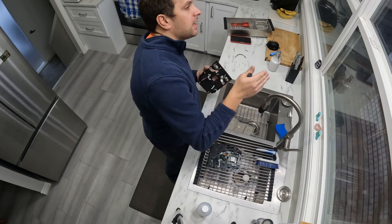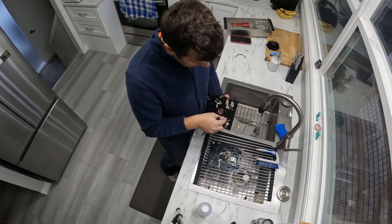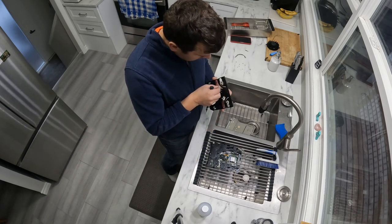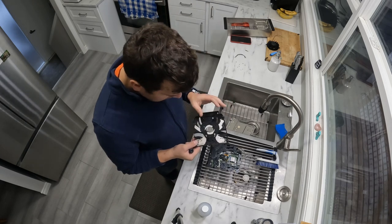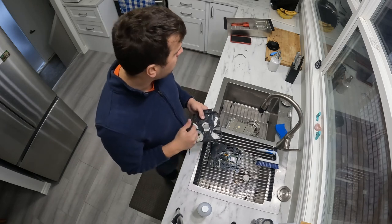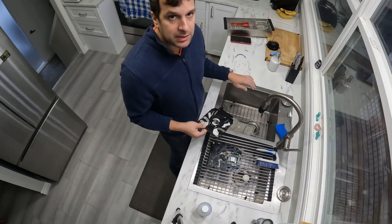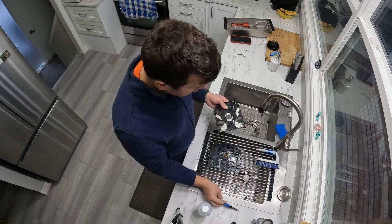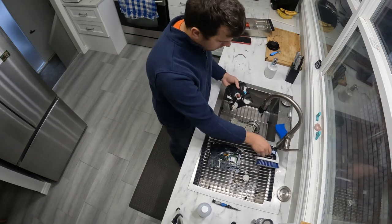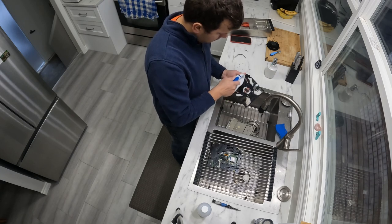On the launch models of the PS3s, both sides had gears to accept the disk parallel into the machine, the drive. Sony did some revisions and cut back on this, so one arm is mechanized. One arm will spin the disk into the machine, and when it ejects it, it spins it out, if you haven't noticed. My guess is Sony wanted to save some money by not having all these little gears in their drives.